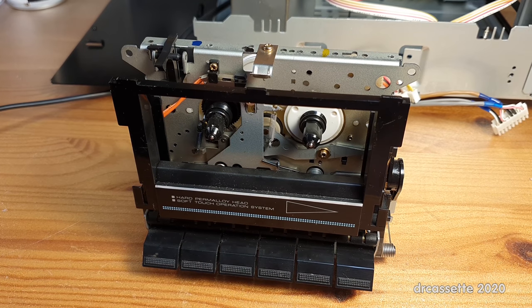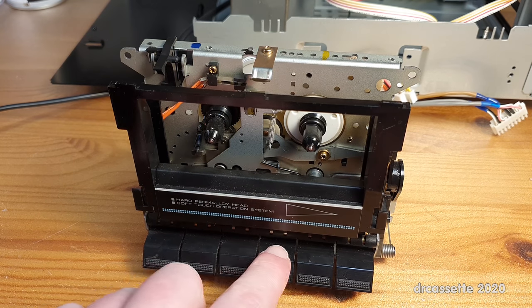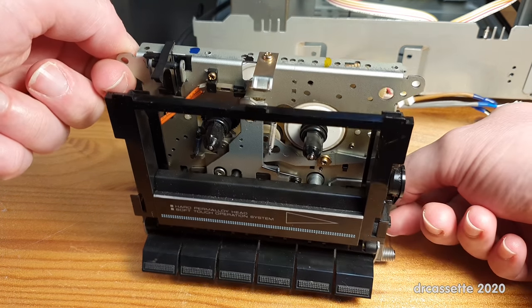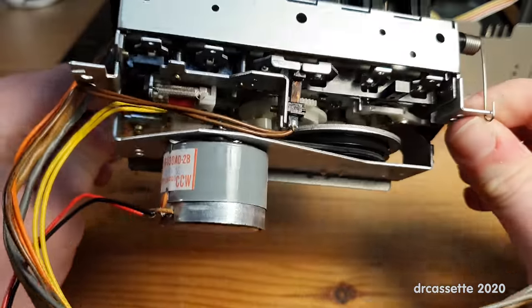Let me try to salvage this video — things got really out of hand. I spent over three hours messing around with this mechanism trying to get it to work. Four main items. The first one: after replacing the belts, I plugged the mechanism into the deck to see if it worked, and it didn't. The play mode worked, but the stop eject button was still stuck being a stop button and wouldn't eject. The buttons for fast forward and rewind were stuck — you couldn't press them. That took a long time to finally figure out.